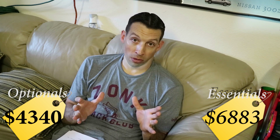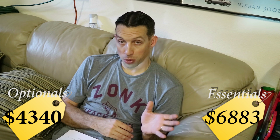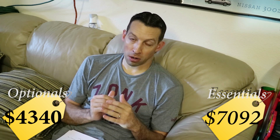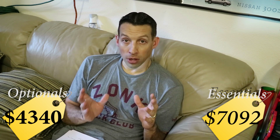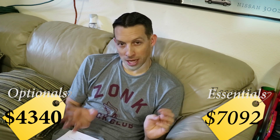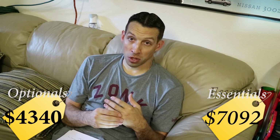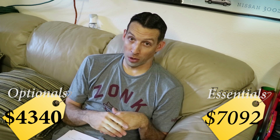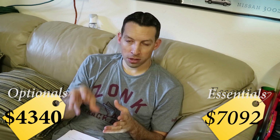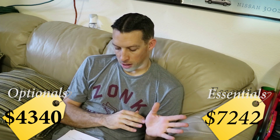I would recommend, to prolong the life of your turbos, you install a blow-off valve. I installed a Blitz Super Sound blow-off valve. I spent $209. That's about what you're going to spend on any blow-off valve. It's all up to your individual preference in the way you want it to sound. I'm more of a whoosh and less of a whistle. I went with the Blitz. If I had to do it again, I would go with the Apexi twin chambers. Those are my favorite sounding blow-off valves, but they don't exist anymore. And to weld the blow-off valve flange onto the piping, about $150 is what they charged me for the welding, so there was that cost there.